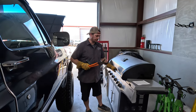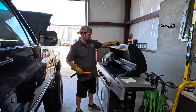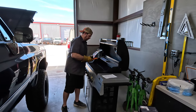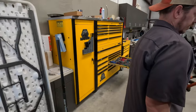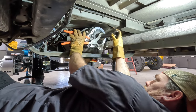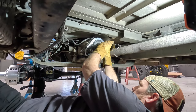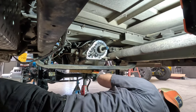In order to get the proper speed signal from our four-wheel drive conversion, we have this gear that has to be installed. It's an interference fit — she's at like 100 and some odd degrees, maybe 200. We're coming over here and we're gonna drive this puppy on. We're making progress, about halfway through.